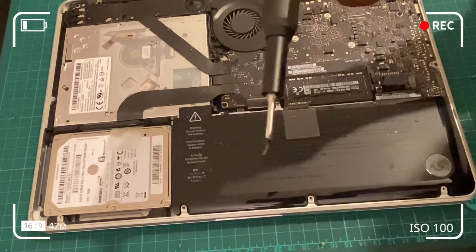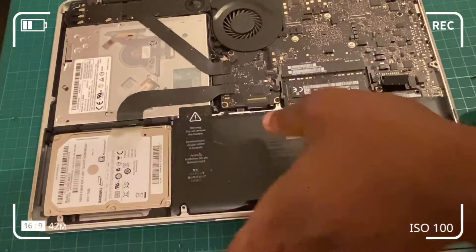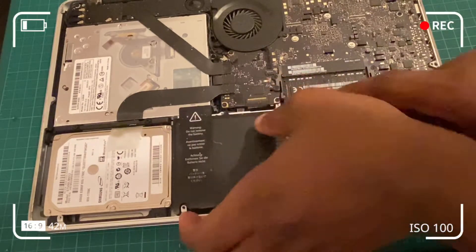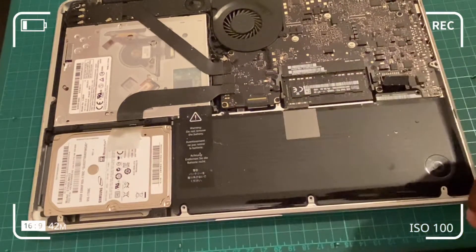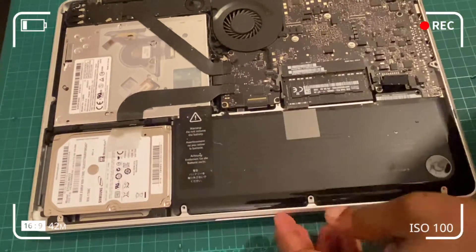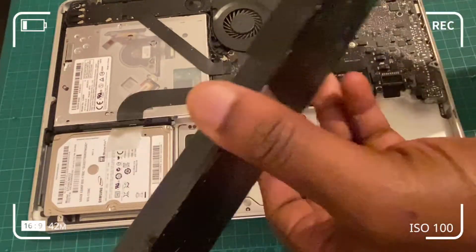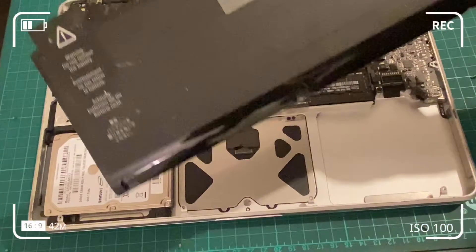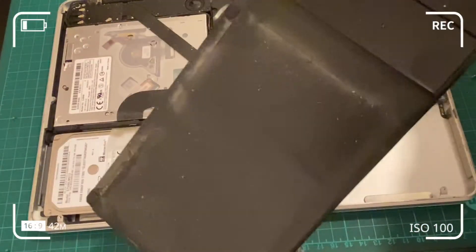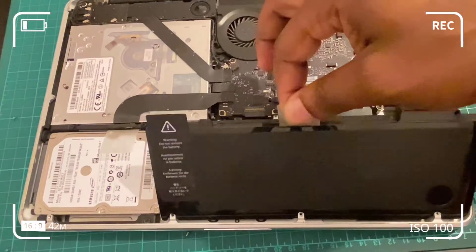Be careful if your battery has been dislodged — make sure any broken plastic bits do not get underneath the motherboard. It's always a good idea to discharge your battery to about 14% before carrying out this activity, so that in case of a puncture you don't risk any hazards. Around 10 volts is fine for a discharged battery — just let it run down naturally.